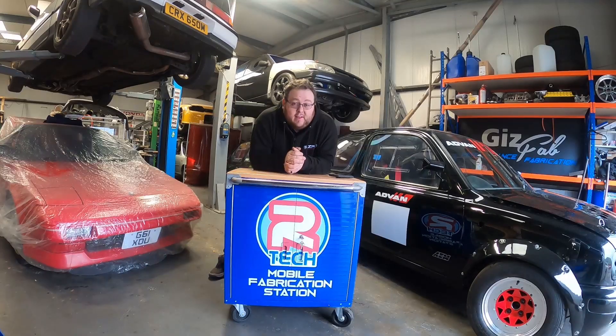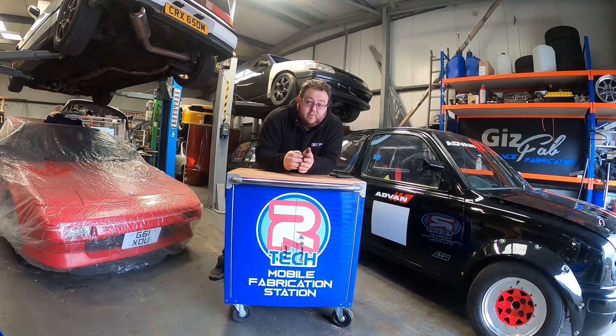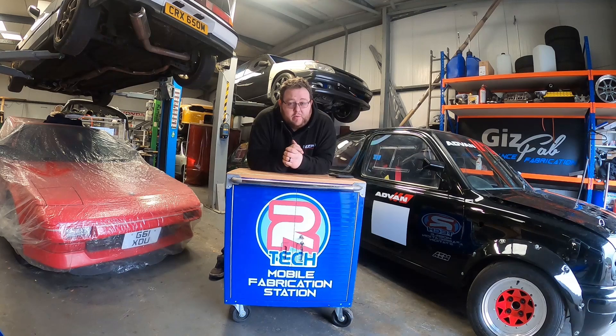I intended to film this video months ago when we first built the Artek mobile fabrication station, but because I'm filming it after the season's ended I can give you many examples of how this has saved not just us but all competitors. Winding back to Oulton Park earlier this year - in the second session we had a weird backfire through the inlet manifold when I changed gear, which caused the inlet manifold to split wide open creating a permanent vacuum leak - about a six inch stretch of sheet metal came away from the base plate flange.